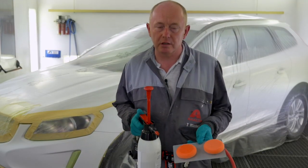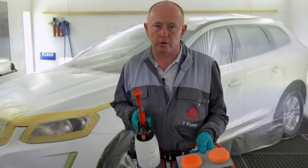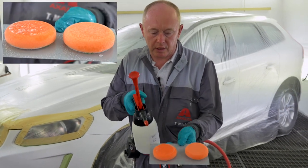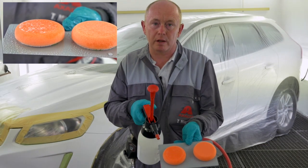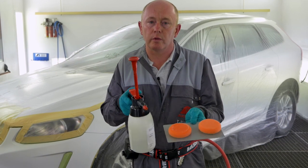Using these sponges, let me show you the benefit of activating and hardening the ground coat and the blender in the first stage. As I spray the water, you will see it is not absorbed into the surface. This means easier wetting of your pearl coat, resulting in a better final finish with improved hardness.